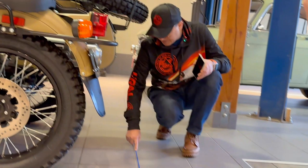So we covered the minimum trailer width, which has no sides, or has removable sides, or has sides lower than 11 and a half inches. A little trick: if you have a side that's 12 inches tall, you can put a 2x4, 2x6, or 2x8 under the wheels and roll it on those, which will elevate the bike to clear that 12-inch side.